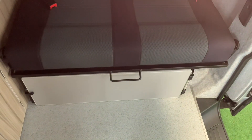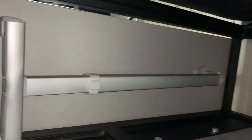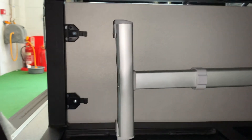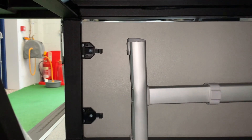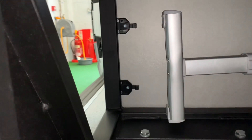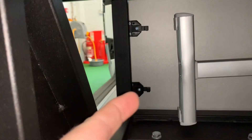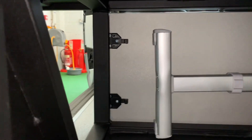Now let's talk about the front — this typically is a table, and I'm going to explain how to get that table out. Looking from the back of the vehicle underneath the seat toward the forward end, you can see two black clips — two little black plastic parts, one there and one there. From the front we're going to reach into the corner of the seat box and just push those across, which will unlock that part of the seat. I thought I'd come around this way so you can see those nice and clearly.